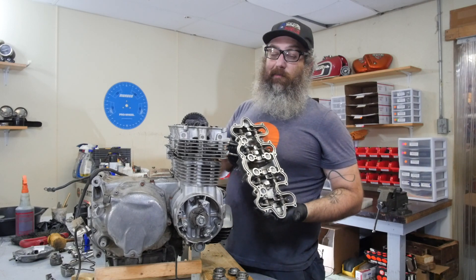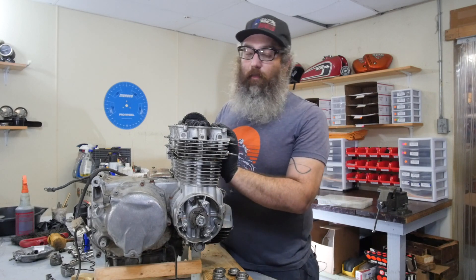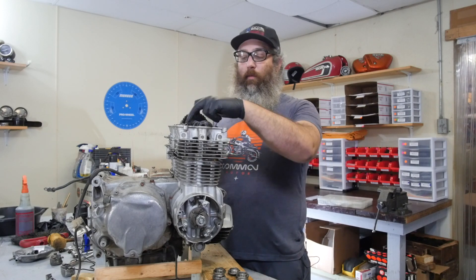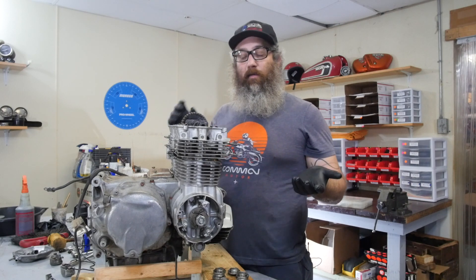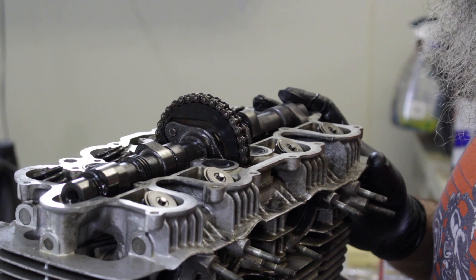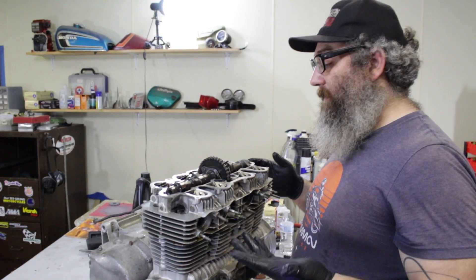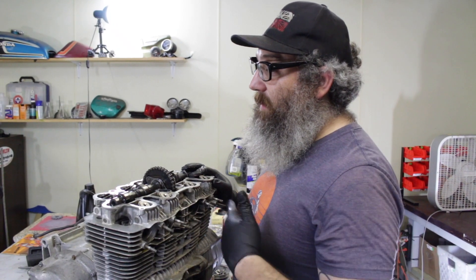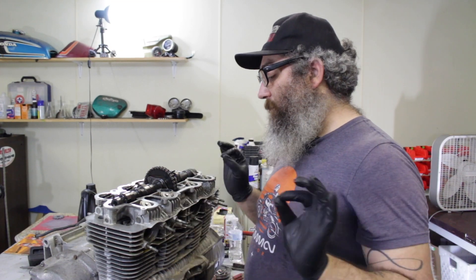We got the top end all cleaned up off camera. The whole point of this operation was to make sure the camshaft lobes are in good shape and not torn up, as well as a visual inspection for anything weird in the top end. We cleaned out the valve cover and the rocker arms — they all look like they're in great shape. Another great sign was there was oil in the top of the head, in the little wells where oil is supposed to collect and the lobes dip in.